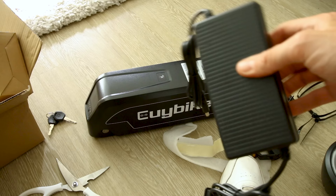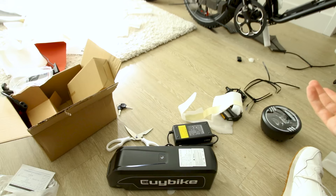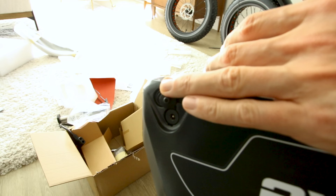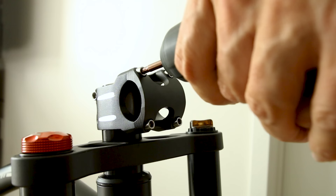It's a two amp charger. So a two amp charger with a 25 amp hour battery - 25 divided by 2 - if you ran this thing down to empty it'd take you like 12 hours to charge from empty to full. Now the good news is you could upgrade the charger to something stronger, three amp, maybe four amp or more. Seeing the price of this bike I knew they'd have to be cutting corners somewhere, but that's it - it wouldn't be much to upgrade.